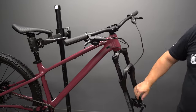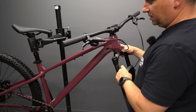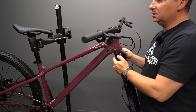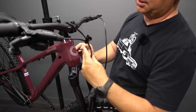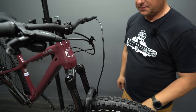All of those are easily fixed. I don't know if it's worth it to me to reroute the shifter through there. If I were keeping this bike, I absolutely would, but for a ride review, I might just leave it as it is. I don't know if it's worth the 15 minutes of pulling that through. All right, I decided this was worth routing the cables the right way. I'm a little bit frustrated. I'm a half an hour in.